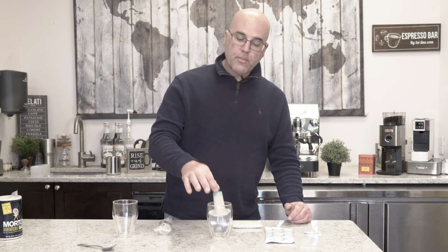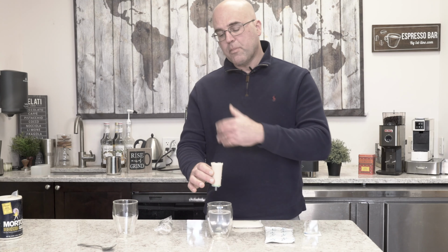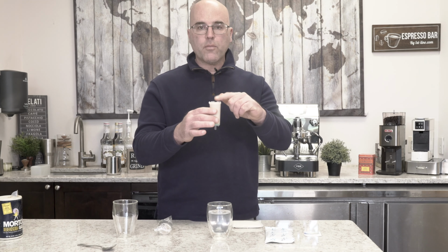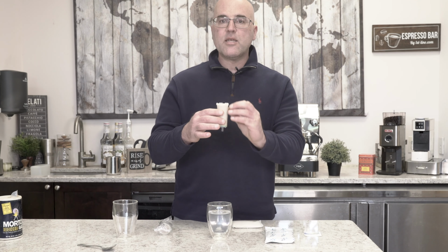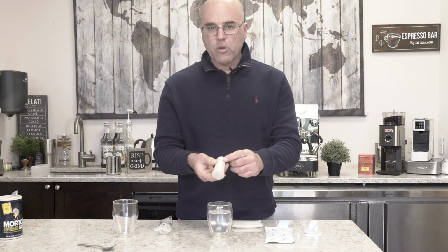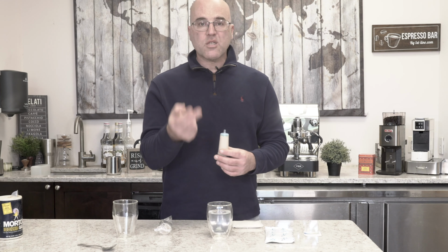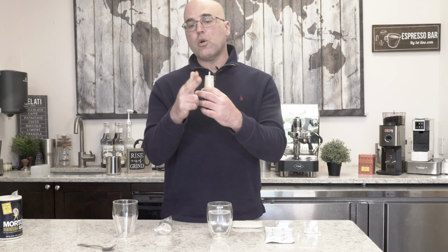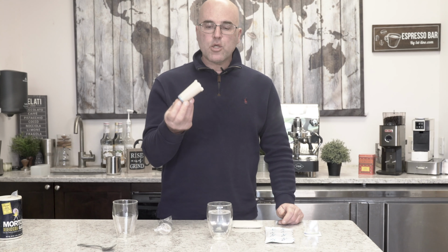So after about 20 minutes of soaking, we have the sink back here, but I'm not gonna turn my back on you. You're gonna run cold water from the larger side through the water softener to get all the magnesium and calcium to come out. You're basically dirtying the water softener. Reattach to the longer hose, and if your hoses are the same size, try to figure out which one's the intake. Sometimes it has like a V cut or a cut on an angle on the intake hose. That's how you'll know. And just make sure it's soaked.